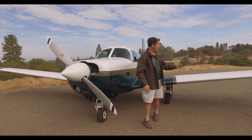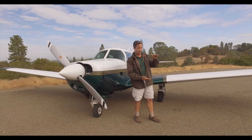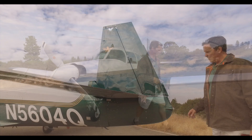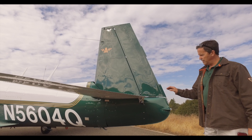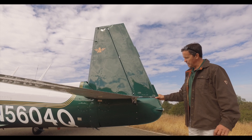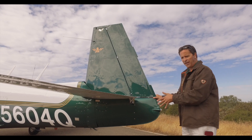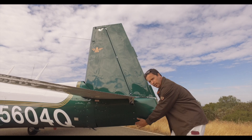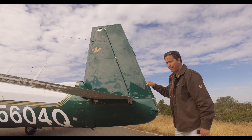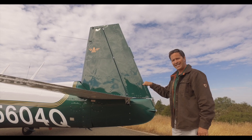At the back on the rudder, the C's and the E's have a short rudder — the rudder only goes to the top of the tail cone. So the rudder on an M20E ends here, like a lot of planes. The C's and the E's, the short Mooneys, end like this, and the G's and the F's and everything above them go all the way to the bottom of the tail cone. So this part is rudder as well, whereas in this it's just that piece. That's a very big identifying feature of the M20E and the M20C.